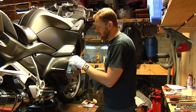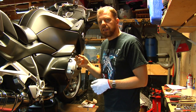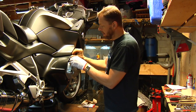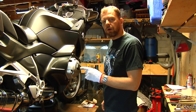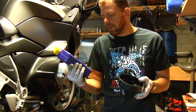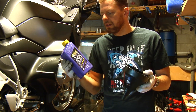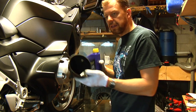On the right side of the motorcycle there's a fill hole here, and it takes the same tool as previous models. Just simply move the plastic a little bit up and unscrew it. Before putting oil into the engine, don't forget to put in the oil drain plug with the new crush washer. For this bike I'm using Royal Purple fully synthetic oil — it's 10W40. BMW recommends Castrol oil, but I believe any good quality synthetic oil is fine — Motul oil is good too.